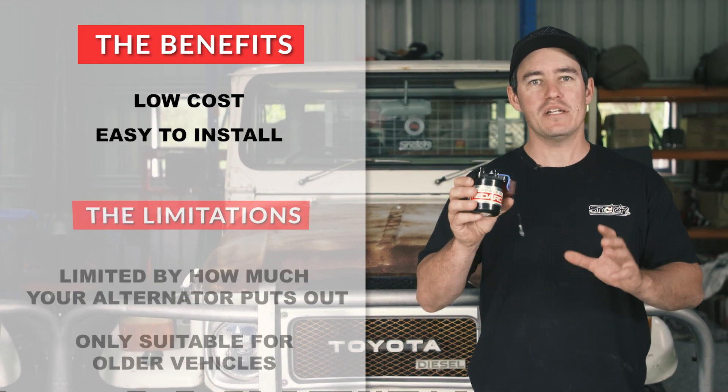Sooty's ready for just about any big trip around Australia, and that's largely thanks to the 12-volt system. It's running a Manager 30. A Manager 30 will charge a battery just like any other DC to DC 30-amp charger, but the really cool thing about this one is I can monitor exactly what my batteries are doing. When it comes to monitoring your batteries, there's three things you need to know about. The first one is very obvious: how much charge your battery's got left. This little screen tells me the percentage of battery life I have left because I've plugged in how many ampere-hours my batteries are.